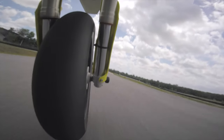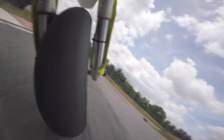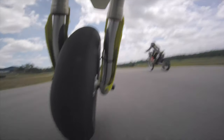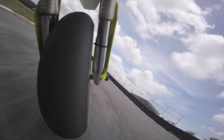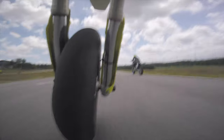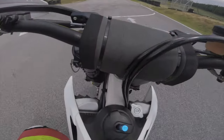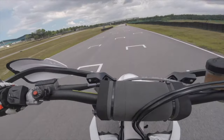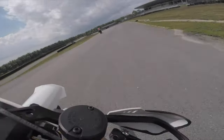I didn't have that same feeling with the air fork. Now here's my qualification: do I truly believe the air fork is a worse performer than the coil spring? I truly don't think that's the case. I think that if you were a high-level enough rider — professional enough — it wouldn't matter. You would basically ride through the strange feelings you get on the air fork and it will perform just as well, except you save a little bit of weight and have the ability to change spring rates easily. I think that at the highest level of riding, they are functionally equivalent — the only difference is how they feel. Where the benefit comes is to lesser riders like myself who value confidence-inspiring behavior from their suspension. If that's you, I strongly recommend you consider buying this spring kit for your FS450 or any supermoto bike, regardless of who makes it.